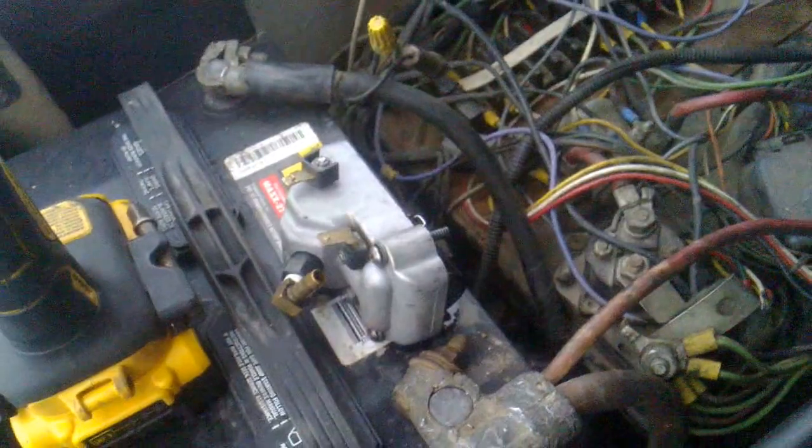When I do this I'm going to get maybe half a pint of diesel leak out the back here — you'll see it pour out. It's not a ton but it does make some drippiness. So I'm just going to put my head cover aside, and if we take a look down in here we can see the throttle lever here actuates that.